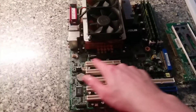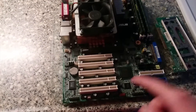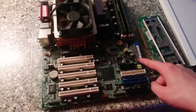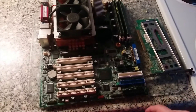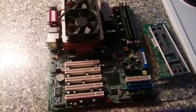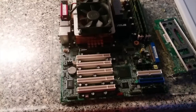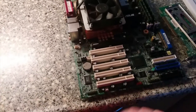So what else does this board offer? There's an AGP-8X slot, five regular PCI 32-bit 33 MHz slots, and a Promise RAID controller on board which sports two SATA connectors — four in total — and one ATA-133 port. I'm guessing the remaining ports are run by the onboard controller of the 875P chipset, located under the black ASUS heatsink. There's also floppy support, which you need to install Windows XP or Windows Server 2003 onto a SATA drive, or when using the RAID controller to connect any drives.